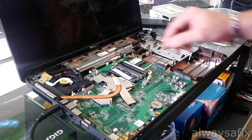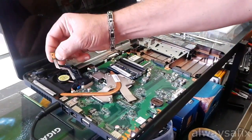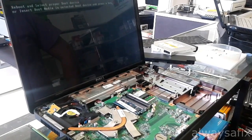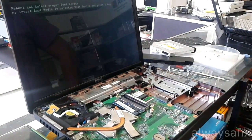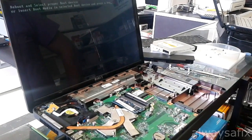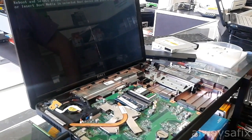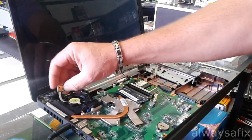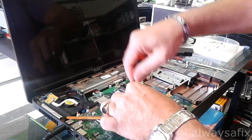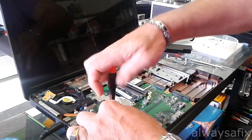We've got the motherboard back in. I've just connected the power switch here so we can switch it on and see if it boots. There we go — the laptop's working now. We need to make sure this laptop never overheats again, otherwise we'll have the same problem and might end up needing to re-ball that GPU. Some other things we're going to try here: underneath the heatsink we're going to put fresh thermal paste on the processor and on the GPU.